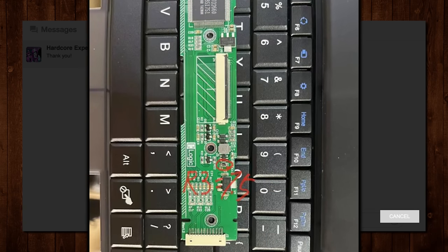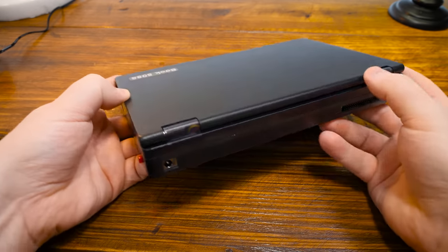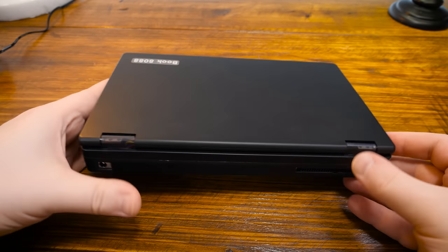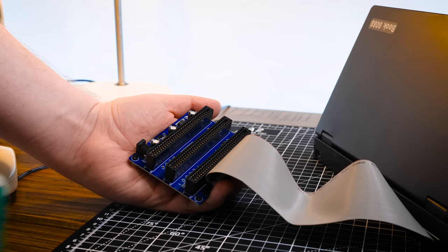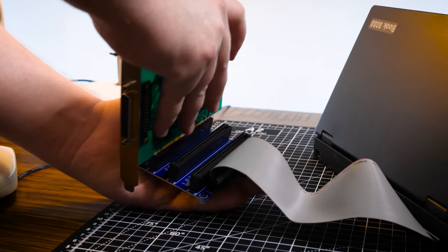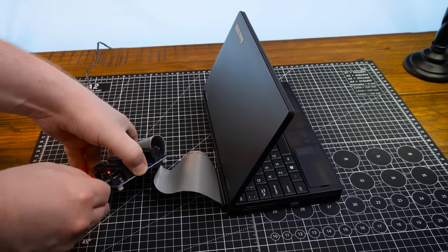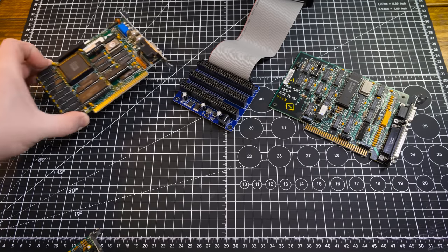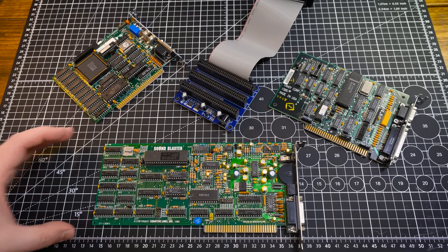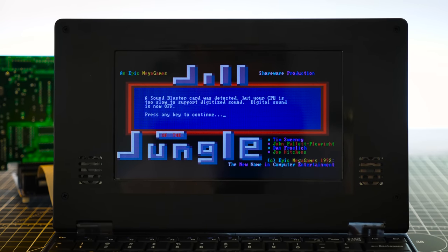Speaking of nothing, how about the 8088's lack of I/O — meaning no video out to bypass that LCD, but also no joysticks, no serial or parallel, and no keyboard connector. That being said, at least you have this: an external ISA bus expansion board. This add-on took the system from being just 'oh that's kinda neat' to 'ooh I have to have it.' Use a ribbon cable to connect to the PC, plug in the same 12-volt power supply that charges it, and enjoy a trio of 8-bit ISA slots. A good number of cards you could add to an original PC XT work great here — like sound cards, disc controllers, I/O interfaces, and so on. Adding an 8-bit Sound Blaster is possible too, not that there's much to use it with considering the 8088 plus CGA combination, but still, it's neat to try.